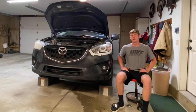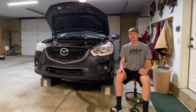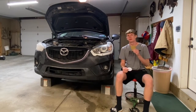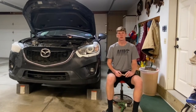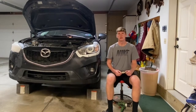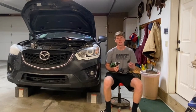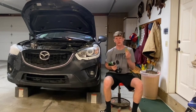Now that we've got the headlights clean and taped around, we can finally start getting into the real process. What we're really doing here is sanding down the top cloudy and yellow layer of the plastic. Inside your kit you'll find six 500-grit slips and four 800-grit slips. Start with the 500 — you'll know when to switch to the next slip when the surface isn't rough anymore and you've quit making progress. Before you start, find your power drill, attach your grit adapter, tighten it up, and put your 500 on.